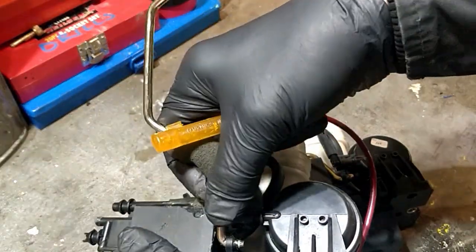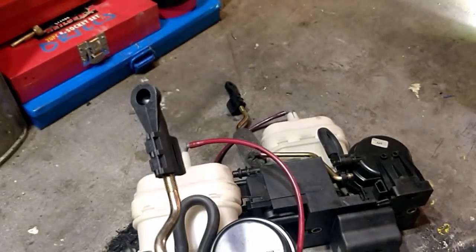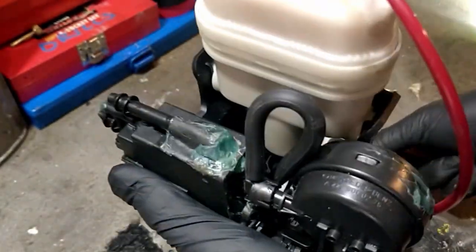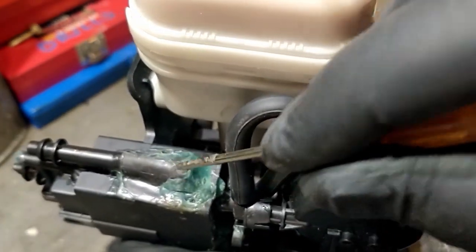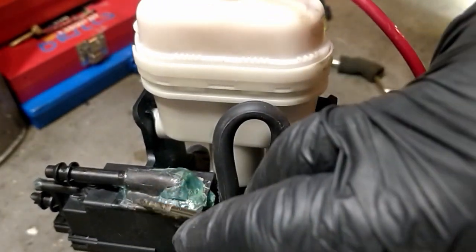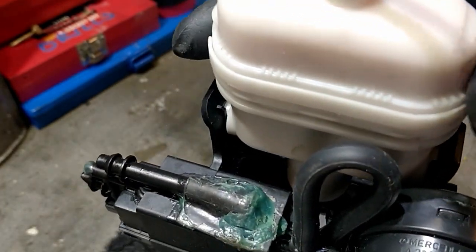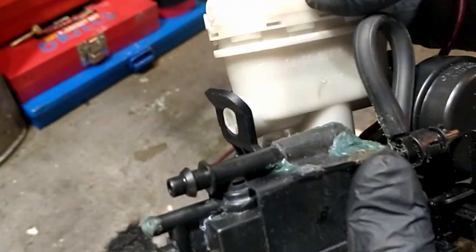First, let me remove this lever — it's the actuator lever that connects via a ball joint on the end and goes to the lock inside your trunk. The number one leak location I've found is the little tube at the top here. It leaks at the back or splits on top — there's actually a seam on it, so look very closely with a decent torch. I've sealed this up with a piece of rubber and some quality epoxy that sets hard.